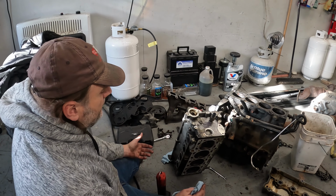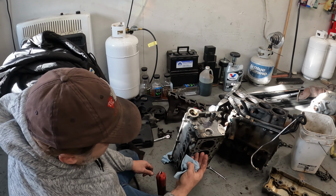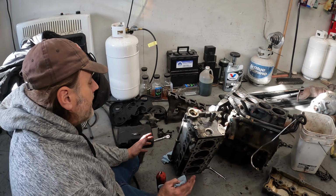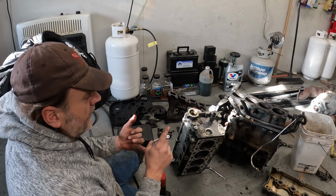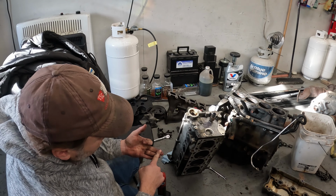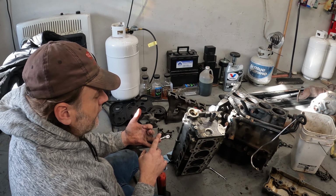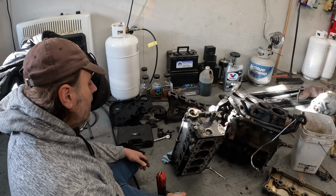We know this motor did run. We know it didn't knock or bang or anything like that. So you're pulling your cylinder head off. You're already going to need 1 valve. So you're sending it out. The labor's the same whether you build the cylinder head, put aftermarket cams or springs and stuff in it. The labor's all the same. So you have all the gaskets to take this apart, all the fluids. Right now it looks like it needs 1 valve. It might need more. You might as well put all new valve seals in it. You might as well have it cleaned and checked, and decked if it's out of round, so when you put it back on, you aren't having any problems.